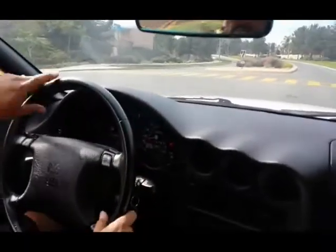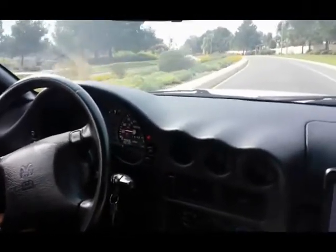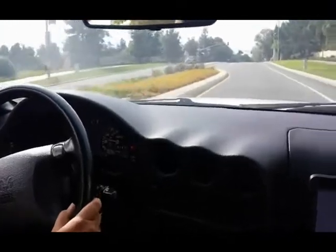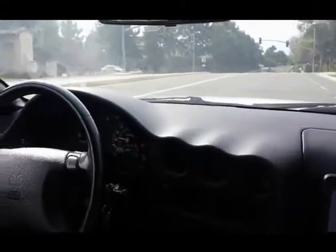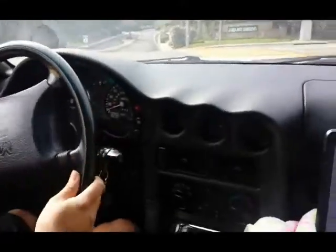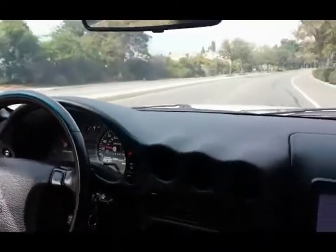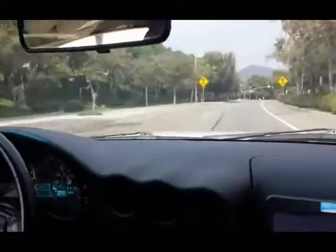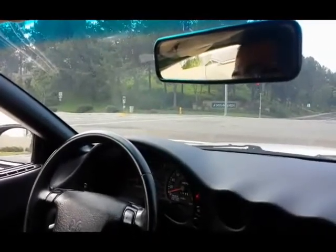Yeah, you're rolling. Okay. So this is Dustin's 96 RT twin turbo, doing initial base tuning. Again, wastegate, 10 psi, shooting for 18, but hit 20 actually. So we're leaving it at 20 for now. It was a very fat tune, 60% through the cycle, 10 flat, on top anyway. Hopefully it pulls like crazy right now. It's really pulling fast. Here we go. Second gear pull. PSI, 400 all-wheel horsepower, 350 all-wheel torque, very conservative.